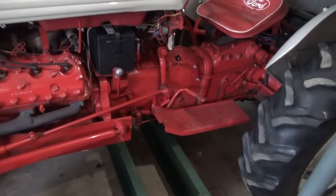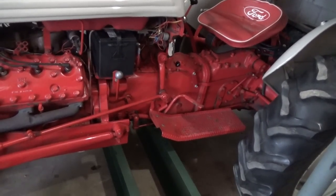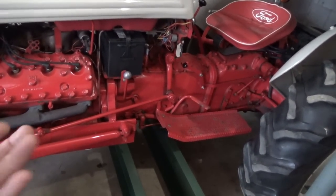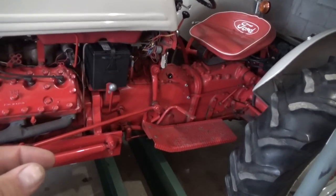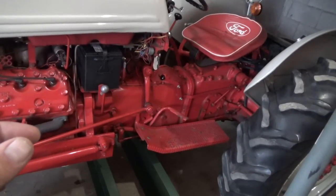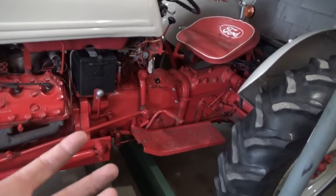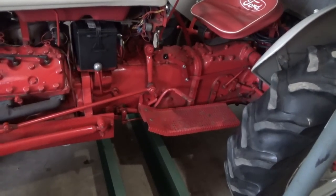Some of them, maybe he's redone it all 20 odd years ago, but now it's sat and it's ran a few times, and maybe a bit of the vibrations have just kind of softened the gaskets a little bit, which, you know, the bolts are the same tightness, but the gaskets have squished, we'll say, well, compressed a bit. And now there's a little bit of a gap there, right? So we need to figure that out.